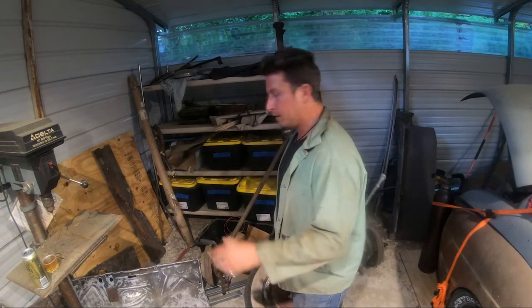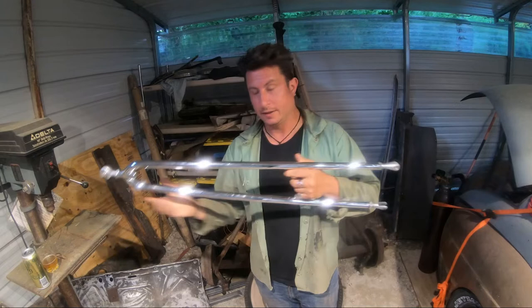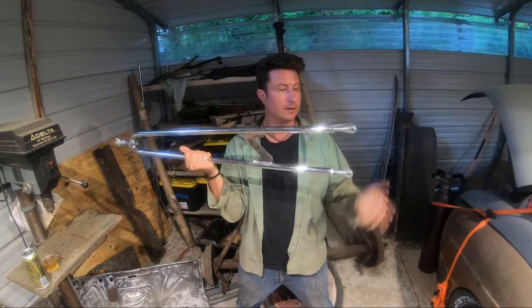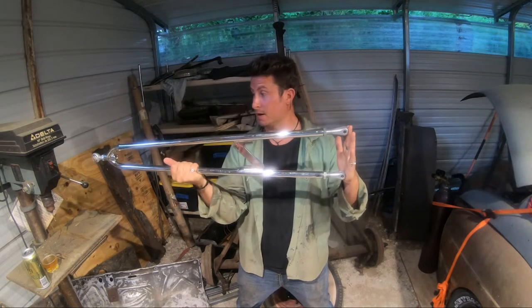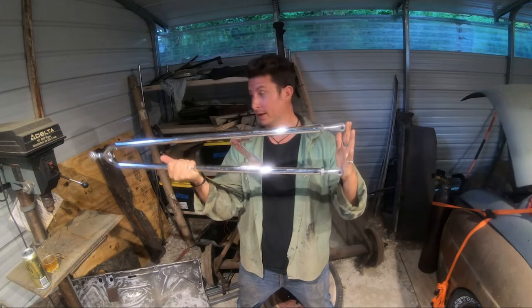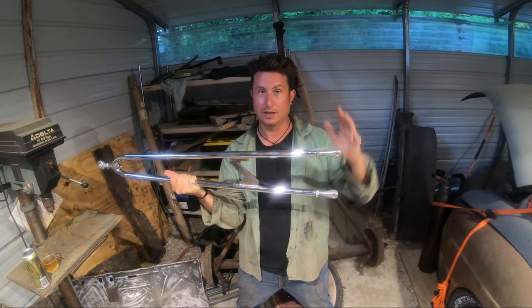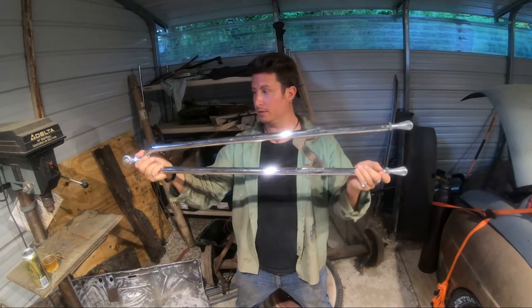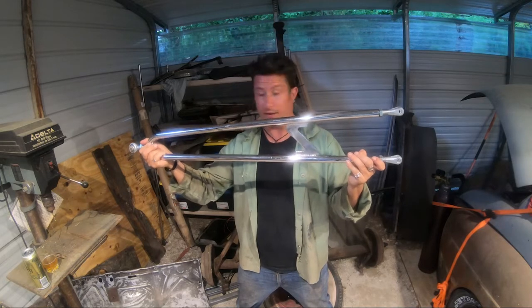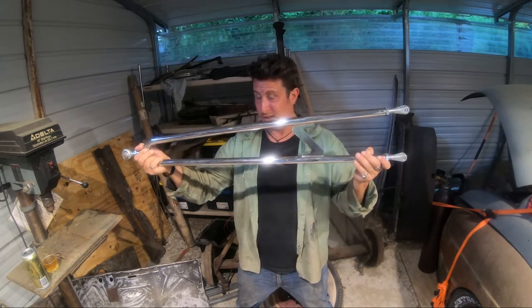Here's the thing. With the rear end and suspension movement, a guy's got to think about all the forces involved. The basic idea is this attaches somewhere on the front of your frame, and this attaches somewhere to your rear axle so that when you accelerate and your rear axle wants to twist up because of the force of the tires on the ground, this stops it from doing that. When you decelerate or go in reverse, the pinion wants to rotate the other way, and this will keep it from doing so. The suspension allows up-and-down attitude, which is what the joint is for. I want this thing at the center of the travel so that when it goes up it goes from here back to neutral, and down here back to neutral.